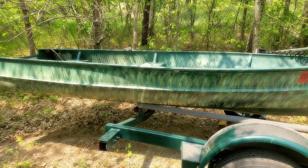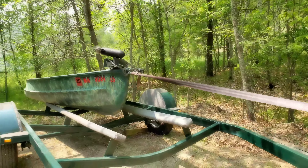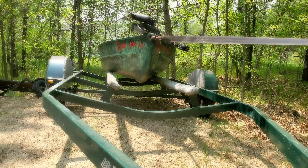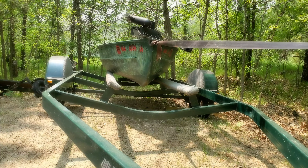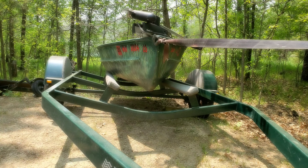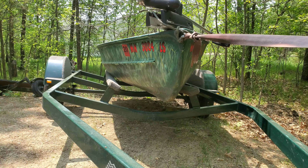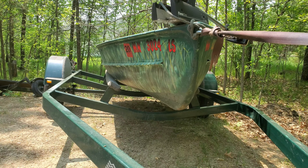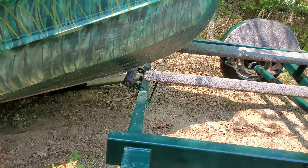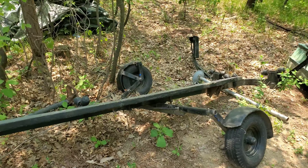Try and get as much of the boat on there while you're lifting up the trailer as you can, because it's easier on the frame of the boat. And then the rest is just like it is at the lake — you just crank it all the rest of the way up. That, my folks, is how you load a boat from the ground onto a trailer. It can be done with bigger, larger boats as well, but if you have a motor in the back, you're going to have extra factors to consider, because you don't want to drag your motor across your yard. It's very helpful if your boat trailer has a roller like this has — then it can feed it right up onto the trailer as you crank the tow strap.